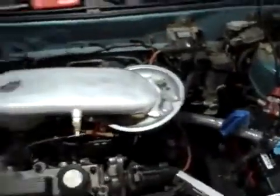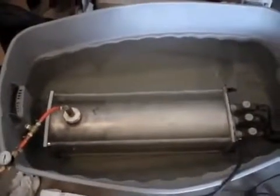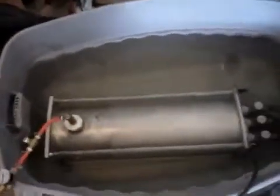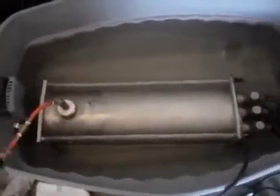This is a special setup right here to allow me to mix this vapor into the carburetor at an efficient rate. The hose going over here to the bubbler, which is bubbling like crazy. And the Advanced Tech's generator, which is sitting in a cooling tub. It is designed to have water flow through it with those 3 white caps you see on top. Water flows through those and coolant comes out the other side. And that is how we're going to cool it when it is inside the car. Again, this is Advanced Tech Engineering, and that's the generator running the Geo Metro.